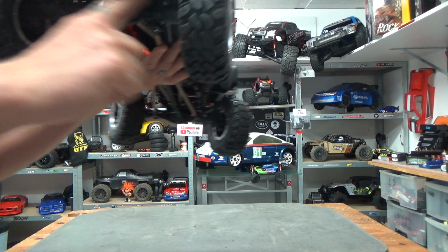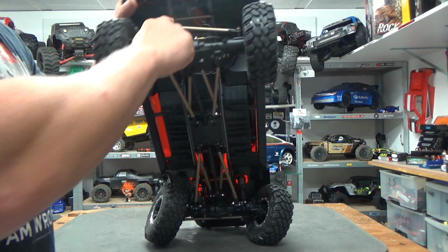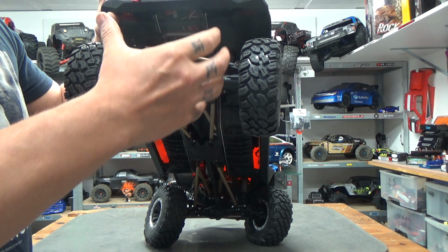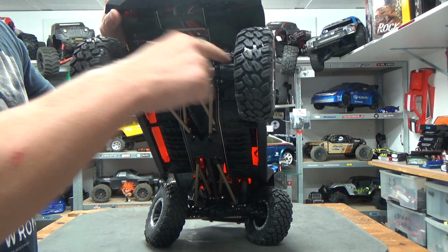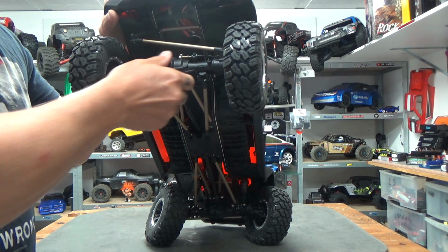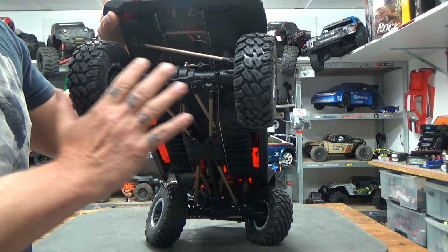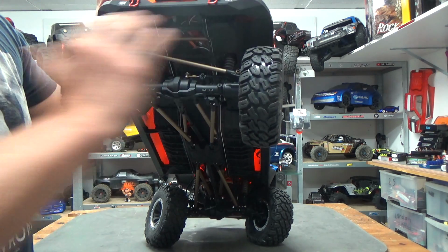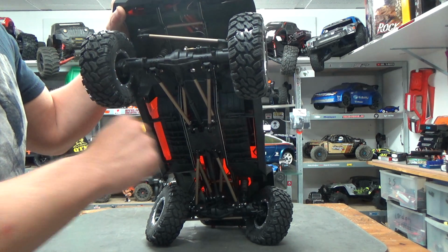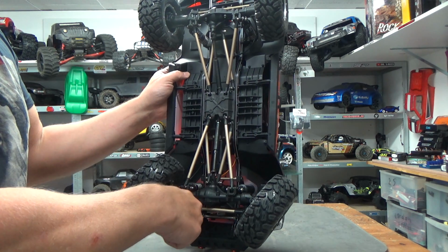First, in the rear we have the panhard bar. You don't absolutely need it because you have a 4-link suspension, so this is not a must-have. And I would say if you put longer shocks, it will be a problem, and you maybe have to bolt it away. They put it here because the truck is able to go fast, and when we drive faster, it's really nice to have a rear axle that doesn't move, not pendulating left and right. You have the diff lock here with a cable. In the front also 4-link suspension, also with the diff lock here.